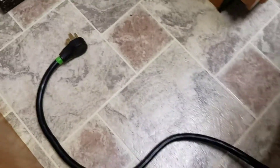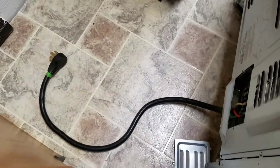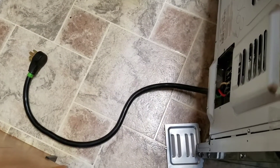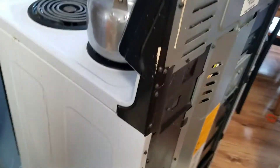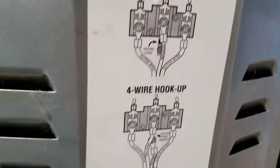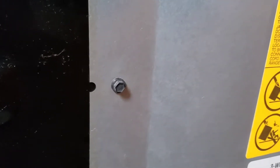Since we're dealing with electricity, you can at your option turn off the power. In this case, what we're doing is just swapping out the electrical cord. Here's the old oven — in the back you have access panels with some information on there. We previously took this panel off. The tool needed in this case was a standard hex or socket — we used a quarter inch.